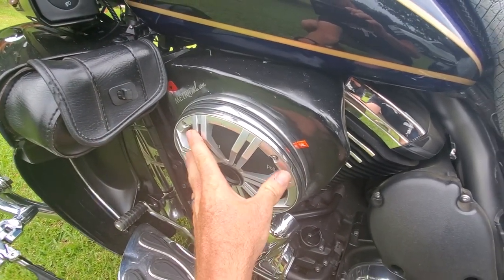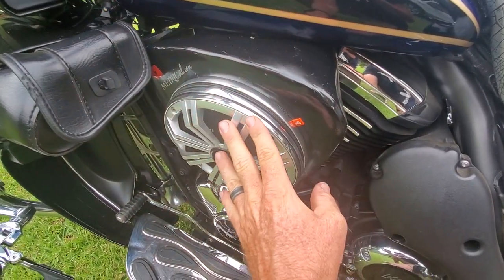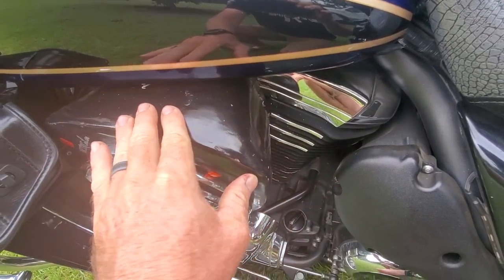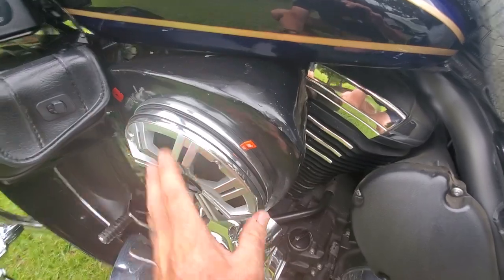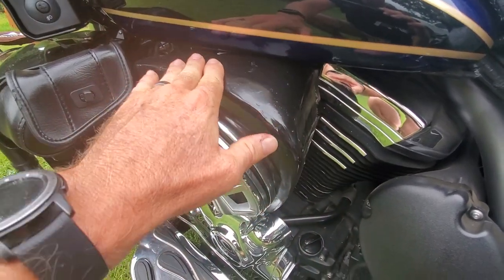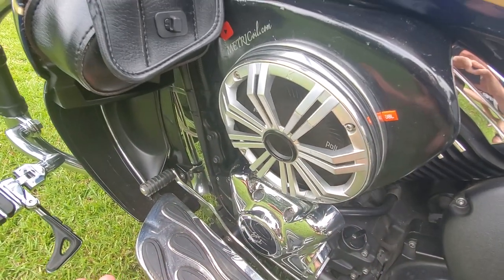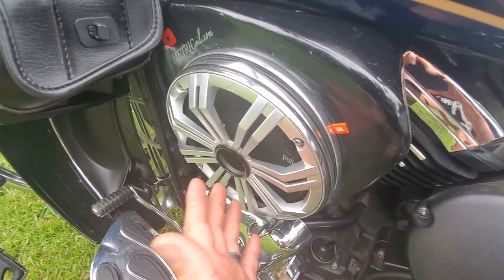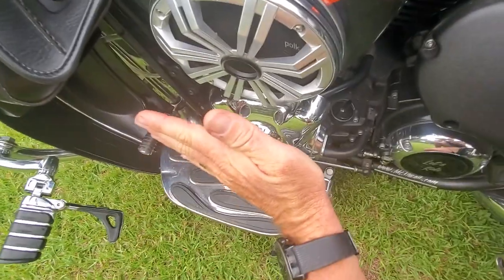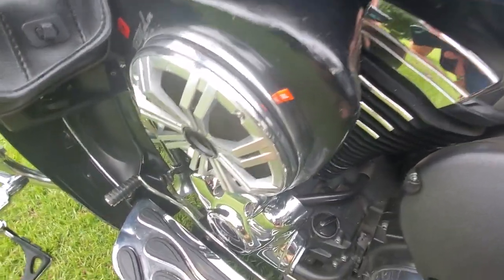There's a speaker on the side. I did a big air kit, which is why I have all this available space — we'll get to that on the other side. This is a fiberglass sub enclosure. It's not going to put out a ton of bass because it doesn't have a lot of air space — probably three tenths of a cubic foot. It probably needs one and a half to two cubic feet to really perform well, but you can't bring it out any further or your leg will hit it. It performs adequately.